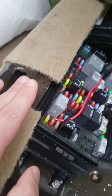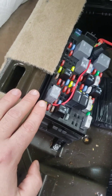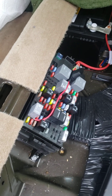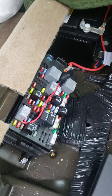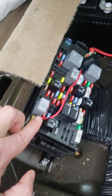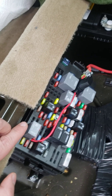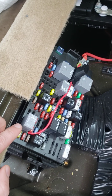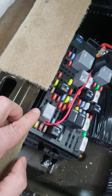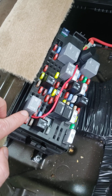Because of that you're going to start blowing relays left and right. From my understanding and research, fuel pumps in this car are actually pretty solid. You can test the fuel pump — if you jumper from pin 30, which is where the red wire is, to pin 87 over here, which runs to the fuel pump itself, you can bypass the relay using a paper clip or something to that effect and your fuel pump will work if you've popped a relay.